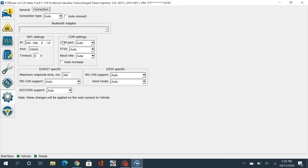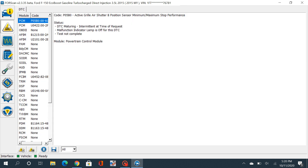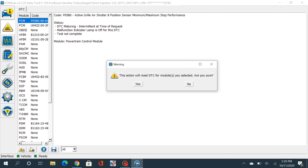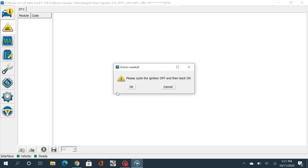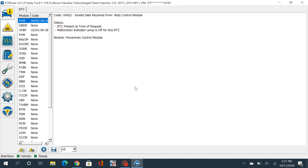You can change some of the comm settings to make it more direct and increase the speed of the connection — for FORScan it might not matter so much, but if you're tuning or keeping track of sensor info you can. Let's go into DTC now and see how quick we can clear these. Click down here, hit reset, hit yes. We'll cycle the engine off and back on. In the past it would tell you to switch from HS to MS and back and forth, but now you just click clear, hit okay, and it's all cleared.